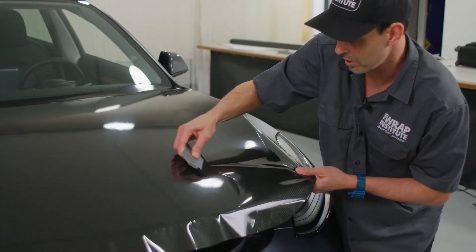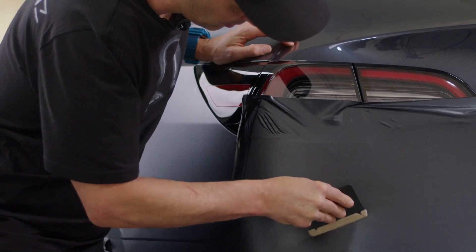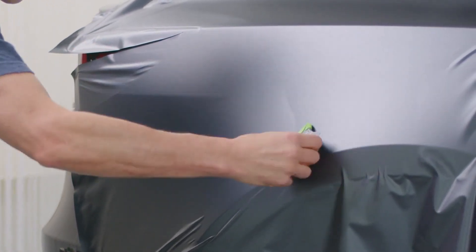With Omega Skins, because you don't have the full air egress feature — you have it in the micro with the repositionable feature — the main thing in terms of install is instead of using your glove a lot, the idea is to squeegee with firm overlapping squeegee strokes, shorter strokes to make sure all the air goes out. If you do get bubbles, they still mostly come away. You also want to install it like PPF. Because the channels are tinier, you cannot spread all the air out completely — you have to do overlapping strokes with enough pressure, and then there's no big deal at all.